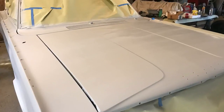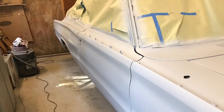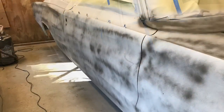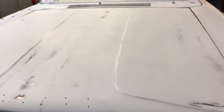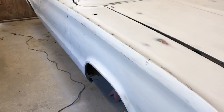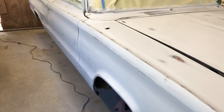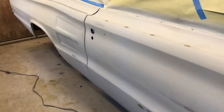I have three coats of primer surfacer on the car, put it on pretty heavy. Then I put on a guide coat, sand that off, and that helps show up anywhere you might have issues. The idea of the guide coat is to sand it all back off so you're just down to your primer — that will show any spots or roughness and give you a nice glassy smooth surface.